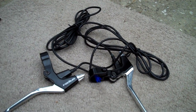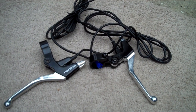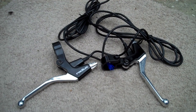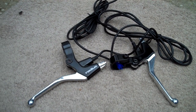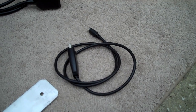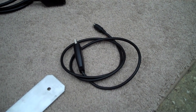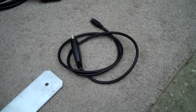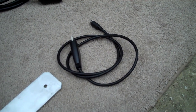These are the hand brake levers. They are a special lever because they have a wire that goes down to your wheel. The minute you trigger that hand brake, the motor itself will go into a regeneration mode — it cuts the power and the wheel then becomes a generator. When it does that, it is taking energy away from your bike and so it starts to slow it down. That can be programmed. This wire here is not part of the kit but it is available. You plug that into the wheel and it allows you to program features like the ability to go in reverse, how fast the wheel will turn in reverse, and the amount of energy drawn in regeneration mode, which controls the amount of braking you can draw off that wheel.